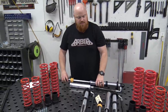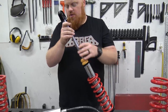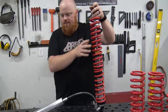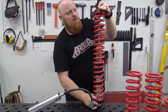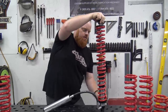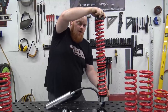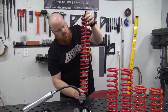These are double spring coilovers. First we're going to put the small spring on — okay, first spring is on. Then take this piece and put the longer side into the top spring, and slide the big spring on. Now take this little top hat, slide it on, then tighten up the preload until we basically have no movement in the springs. You're not trying to preload it right now — you just want to eliminate that gap. That's basically how quick it is to put these together. We'll get them filled with nitrogen at an off-road shop very soon, but they say it's better to test your spring rates without nitrogen first so you can see how much work the spring is actually doing.